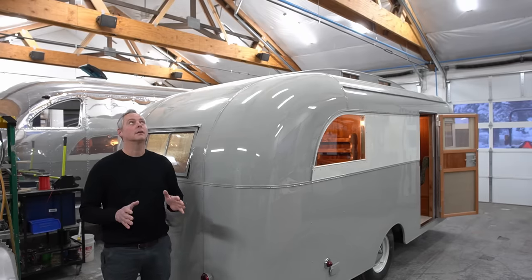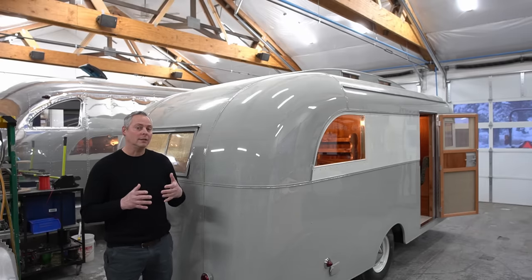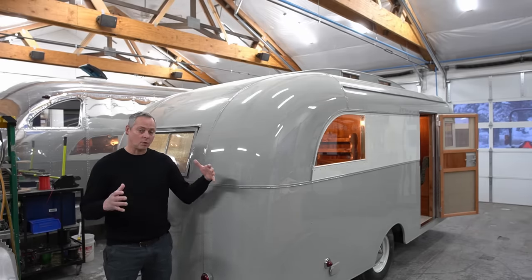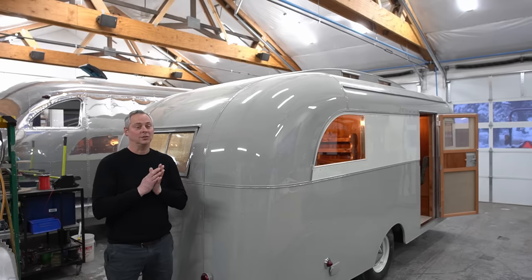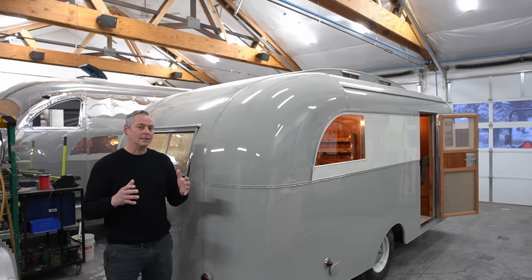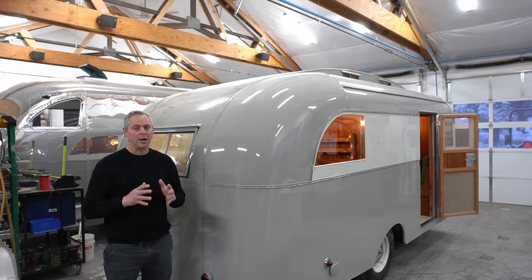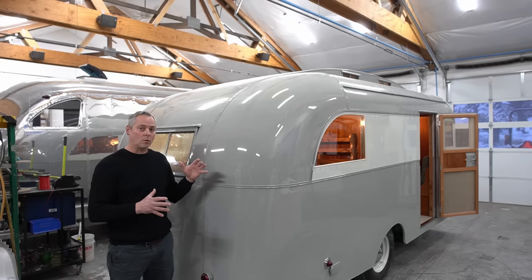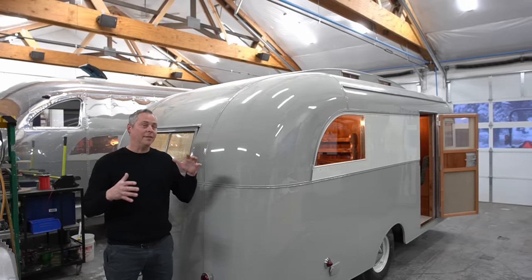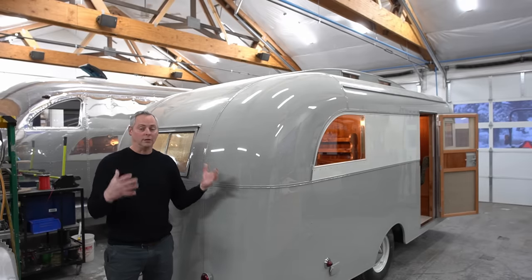Let's talk about these corners. It was weeks and weeks of molding these corners. Originally this trailer did have steel hydropressed corners on all four corners. Unfortunately, because they were steel and it sat out in the weather for quite a while, they were completely rusted through — like cheesecloth rusted through. So we decided to lay all the corners up in fiberglass. That was extremely time consuming. What we had to do was basically use expandable foam on all four corners, then cut it and shape it, then lay it up with fiberglass cloth, resin it, gel coat it, and paint it. A very, very long and tedious process.